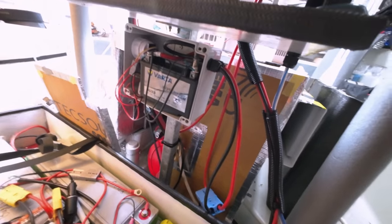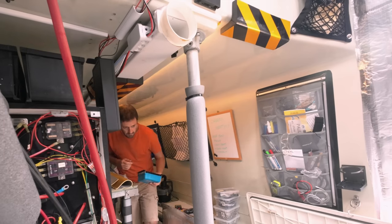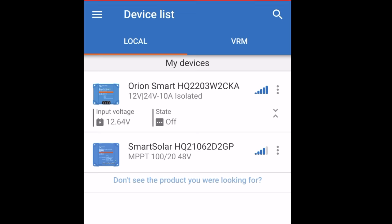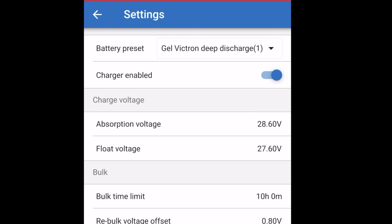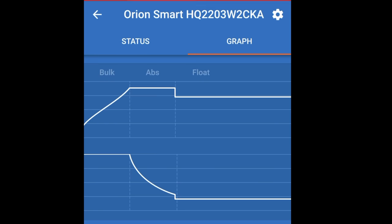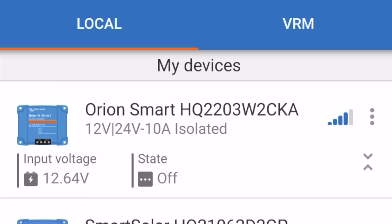The battery was at about 12.5 volts before the crank, so after the mid-crank voltage dip it was recovering back to around that level very quickly. Time for the upgrade I've been talking about - the question is whether you can ever have enough little very expensive blue boxes. It connects with your phone or tablet via Bluetooth in the same way as the solar charge controllers. You can choose to use the unit as a power supply, or as I want it, to monitor how the engine's alternator is charging the 12-volt crank battery and send any excess charge at 24 volts and up to 10 amps to the house bank. But these readings in the mid 12-volt region are when the engine is on, which is odd - something's up with the alternator.